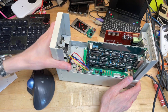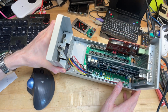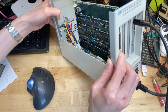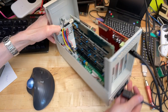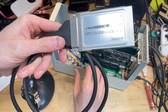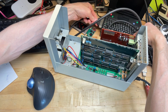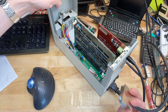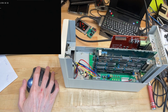Here's an interesting item that I picked up. It's a small enclosure with a power supply and an ISA backplane. I have a PicoGus installed. You can see it also has this one other interface card in it, and what that does is it connects to a PCMCIA card that then allows you to bridge certain IO ranges and interrupts from your computer over to this enclosure — with the idea being that you could use ISA cards on your laptop.